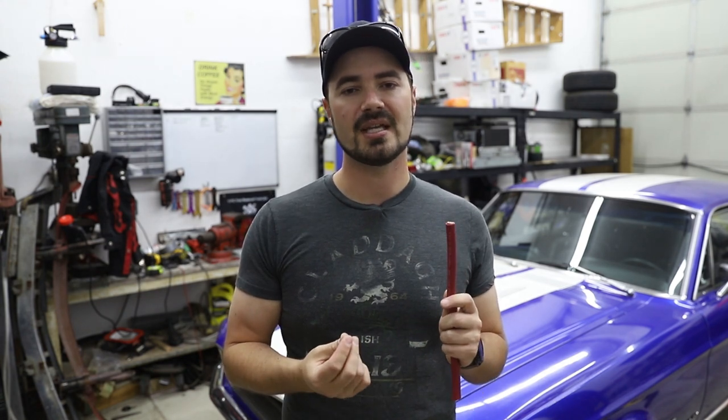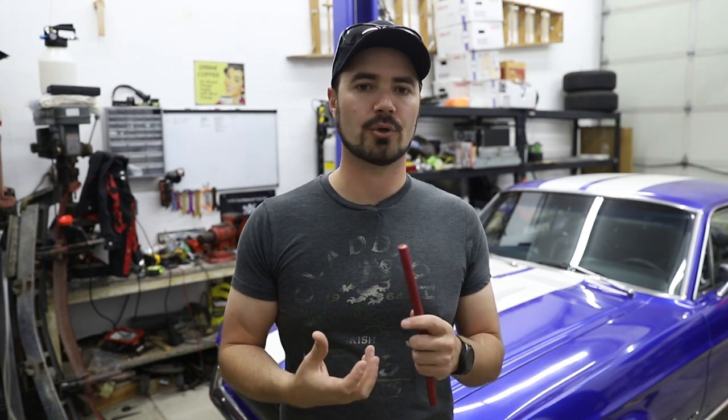Once I had these connections made to the back of the car, essentially the circuit was basically done. I just buttoned up some odds and ends. With the battery box installation, I had drilled the holes to mount it in place — it's held mostly in place by the clamping force of the bracket holding the battery to the floor. I also wanted to make sure that the breather tube, the venting tube inside the box, was epoxied in place to the box so that it couldn't accidentally be pushed out. A lot of these kits come with just a rubber grommet and want you to wedge it in place, but I epoxied it so it couldn't move. I also tried out a couple of different kinds of battery terminals to ensure I had one that cleared the top of the box as best as it could. Then I went back to the front of the car and verified that all my wiring was still tucked and that I hadn't caused any problems that could cause a short. Then it's time for some testing — once I had the car put back together, the best way to test it was a short drive and then to take it to an autocross.